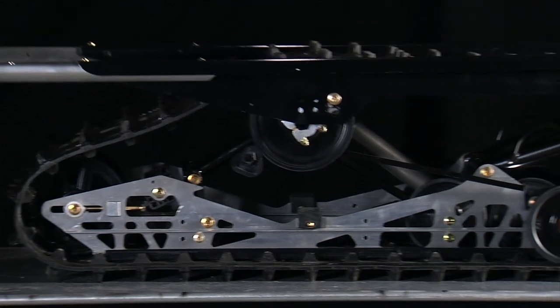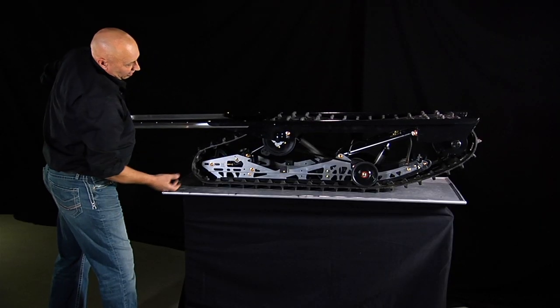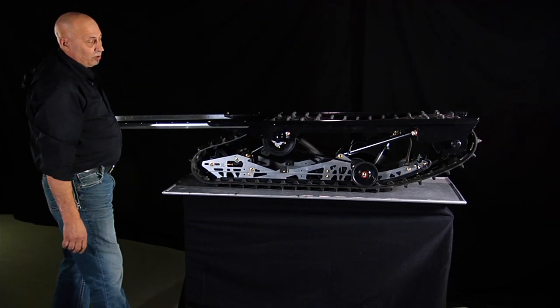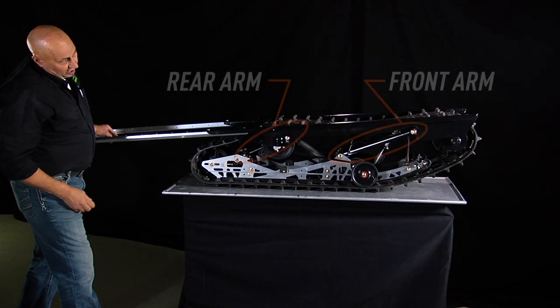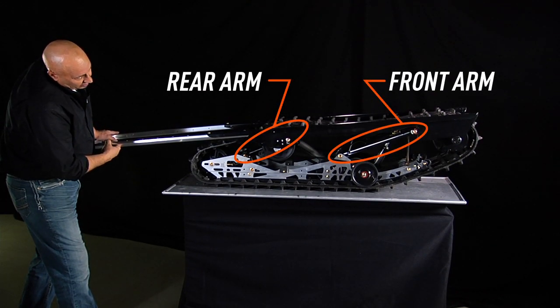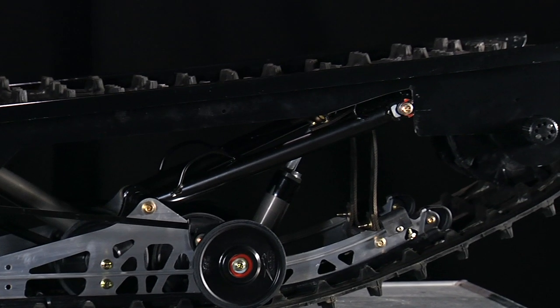The rear is attached to the skid rail and the chassis. If you watch when I move the skid frame, you can see there's what's called a lost motion in the back. So when the sled is being pushed, it can't push through this lost motion — it pushes through the front arm of the skid frame. With our new design, the sliding front arm continues to transfer back and lift the front of the sled.